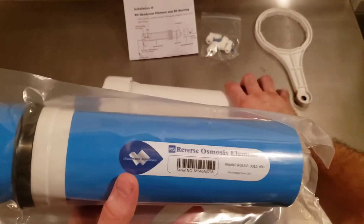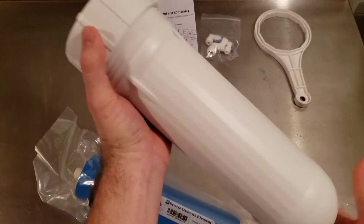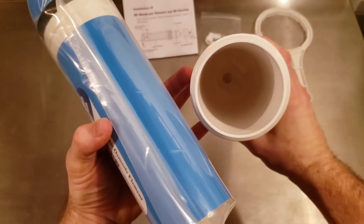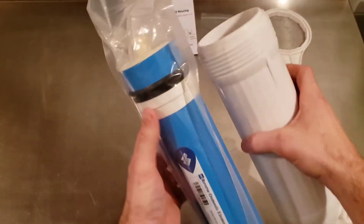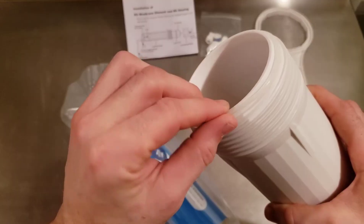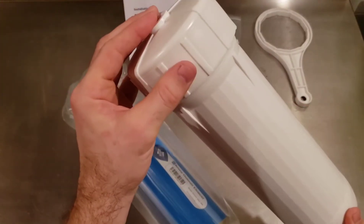When you are ready, you'd unwrap this and insert it right down into the top of this membrane housing. The O-rings on the bottom are going to insert right down into that little port at the bottom of the housing. Make sure this goes all the way in. There's a silicone seal on here — make sure that it is in place and not crimped. Then you're going to tighten that all the way down tight with the membrane inside.